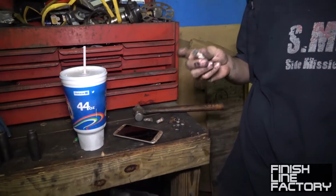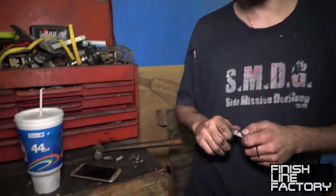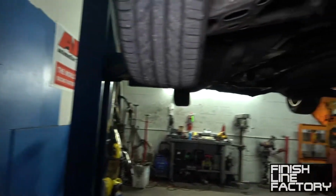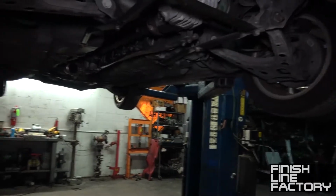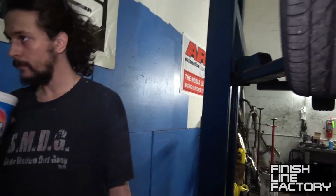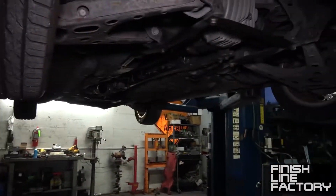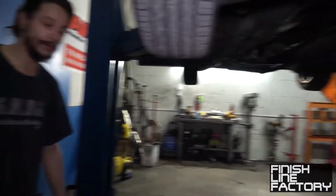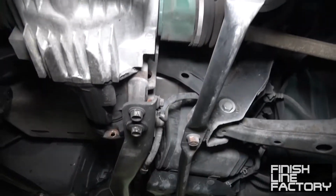You don't want them to be 10.9. You want them to be 8.8. How come? Stretch. For impact resistance or whatever. You don't want them to snap. You want them to bend. Okay, so that when you hit it hard, it'll... It'll be less brittle, yeah. It'll be more brittle. The harder the thing, the more brittle.